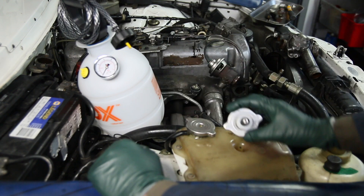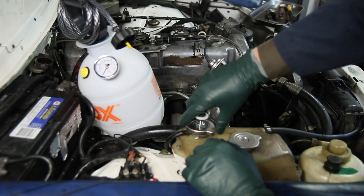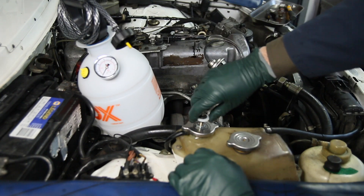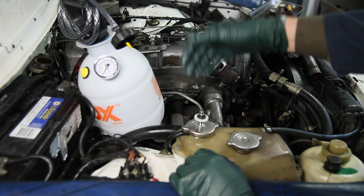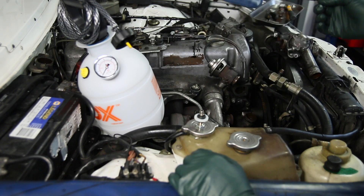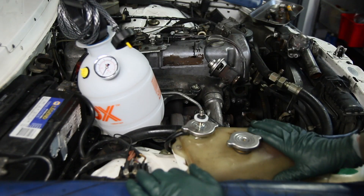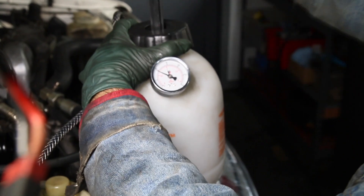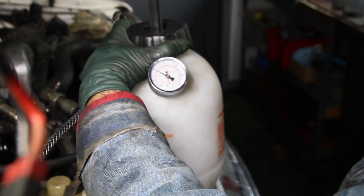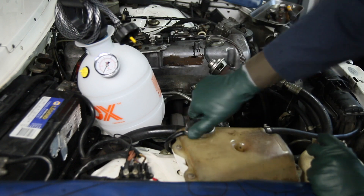This is the second prototype, so we've refined it a little bit. It just replaces the radiator cap — when you put it on either the radiator or the coolant reservoir tank, you tighten it down to seal it, adapt the hose to this cap, and pump up pressure. What's nice is it has a gauge, and you really need a gauge when pressurizing your cooling system. You do not want to go over 15 psi. The tank also has a pressure release right here, and you just replace it with your normal cap when done.